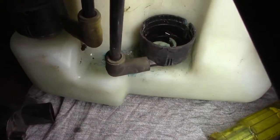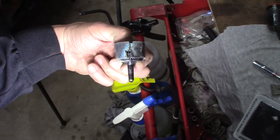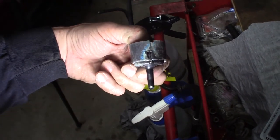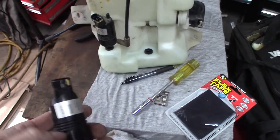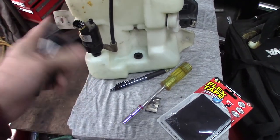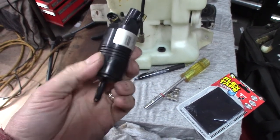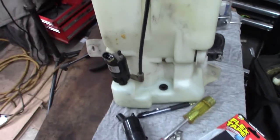About a half inch up there's a ridge — you can see all the blue around that ridge. I think it's leaking past that O-ring and up through it. You can see that slit in the side of the bottom housing for the pump, and all the blue around the top — it's definitely leaking from the inside, not from the grommet. I was originally going to try to replace just the O-ring, but these pumps are so cheap — $25 for both, front and rear. The only difference is the connector. So I'm going to replace both. I also noticed the top ring came apart and cracked, so for the money I'm just replacing them both — new grommets in, put them back together.